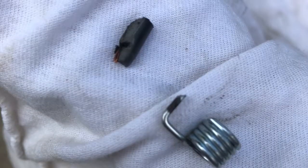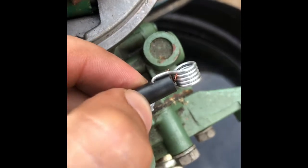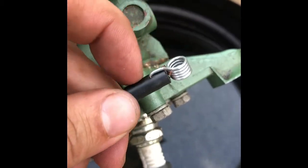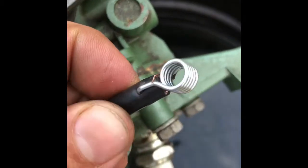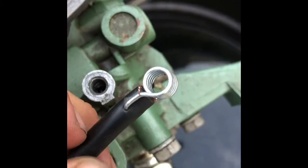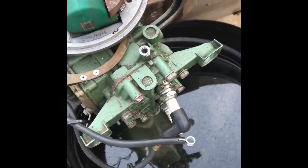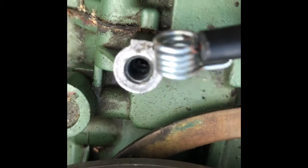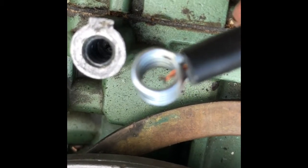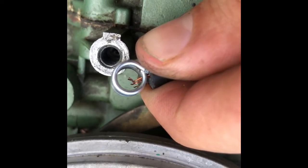I can show a picture — I cut apart the old wire where it was connected previously, and you can see where it was arcing between the spring-like connector and the wire, because it's all black and appears to be fouled up on the inside. That was the final issue causing the intermittent no spark. Other than that, everything seems to be running well. Those wires that were sticking straight out I ended up routing through an opening in the coil so that when you put it over the spark plug it'll have a really good contact.